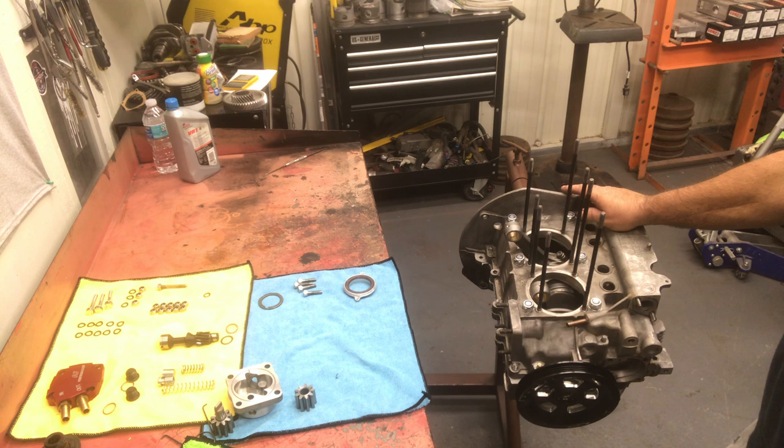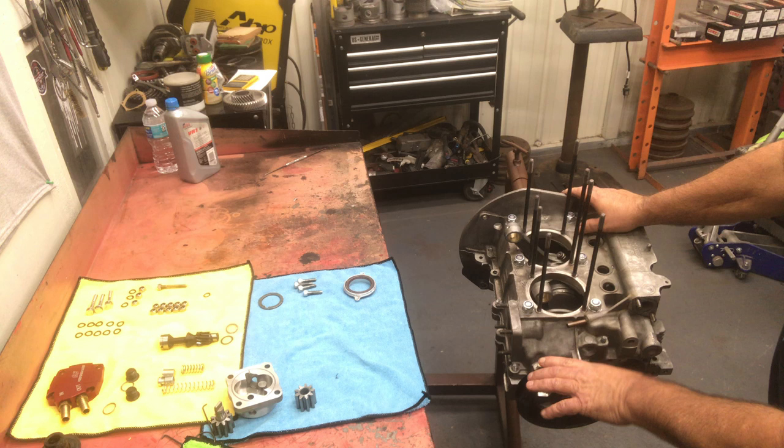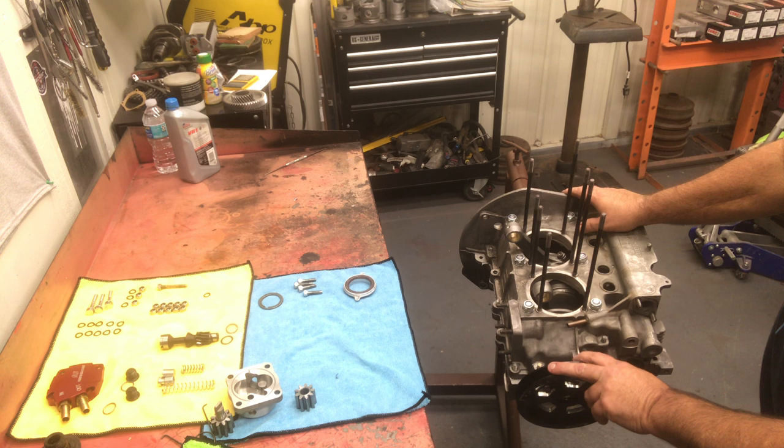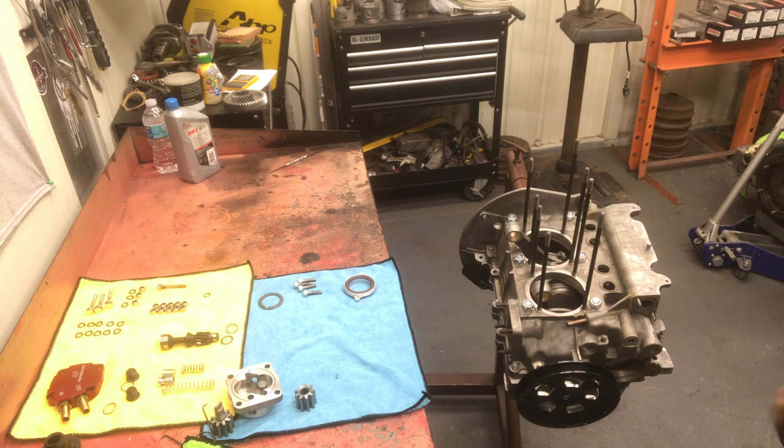So anyway, that's where we're at on Oscar's 78 by 90 and a half motor. We did buy a set of new pistons for this. Not piston cylinders, we bought stroker pistons with the slipper skirt on them, so we'll go over that. I had some ideas from a couple of my subscribers, so I called around, and they weren't that expensive, and went ahead and did that rather than stack a bunch of spacers under the barrel.